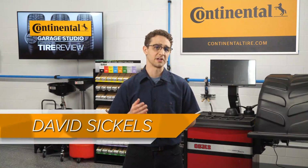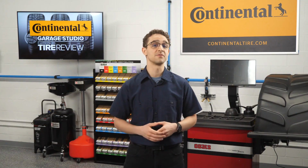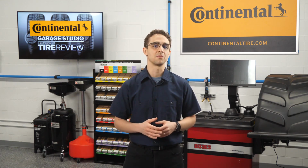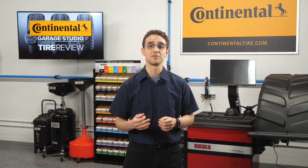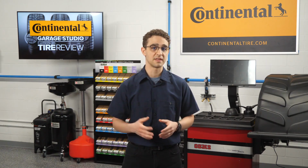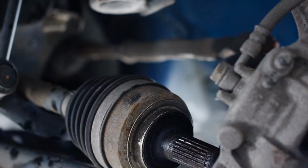Under normal operating conditions, CV joints and boots are engineered to last upward of 150,000 miles. Some go the distance, but a lot reach the end of the road far short of their design life. CV joint shafts are typically being replaced at anywhere from 70,000 to 130,000 miles. What's more, some makes and models are notorious for eating shafts, sometimes because of the relatively thin case hardening used in CV joints.